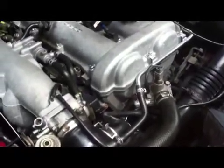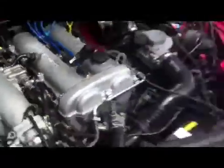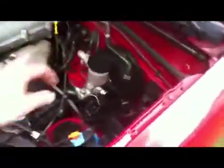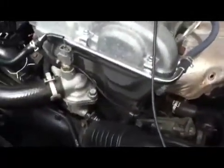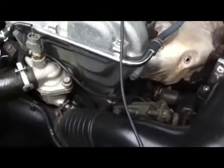We've got it back down to 10 degrees before top dead center. Tighten back the 12 millimeter nut back there, and don't forget to remove the shorting connector from the diagnostic box. Same procedure for bumping your timing up to 12 or 14 degrees before top dead center, or bringing it back to base which is 10 degrees. The timing setting may differ in different countries - in North America it is 10 degrees before top dead center. It's also listed under your hood, so that will always show you what your timing should be.